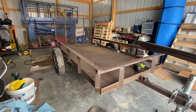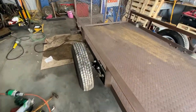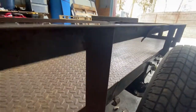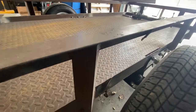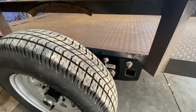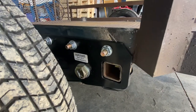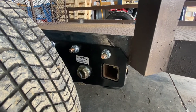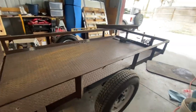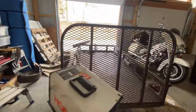These are the 3,500 pound axles on a 4x6 trailer. Some of the things we did here: we had to reinforce the frame when we put this axle in. It's pretty straightforward on installing. What my dad did was basically take a few measurements of the axles and mark the location on the frame. We did run the 2x2 steel cross beam across the trailer to each side. These are the 13-inch wheels that came on the trailer,